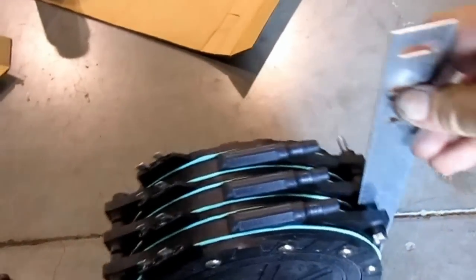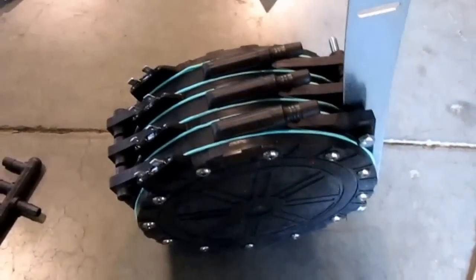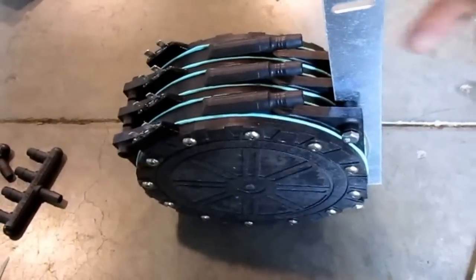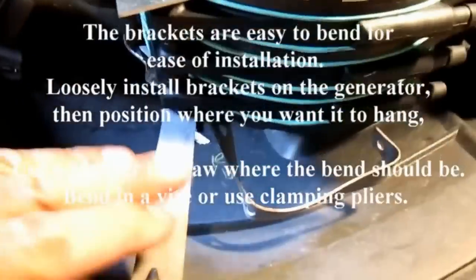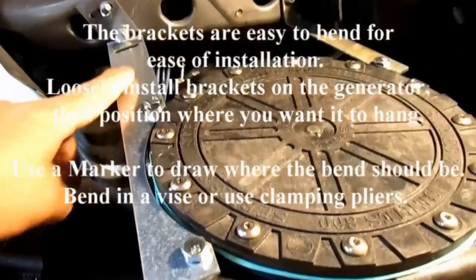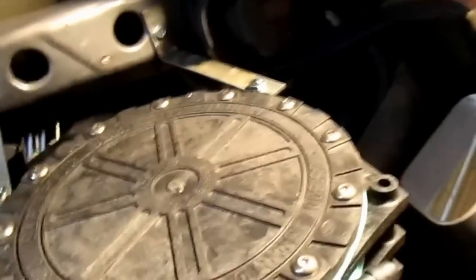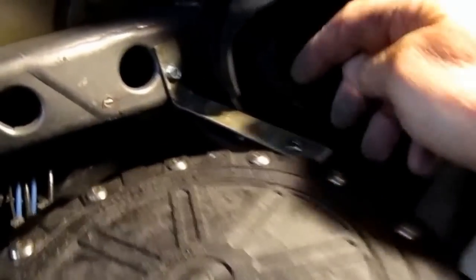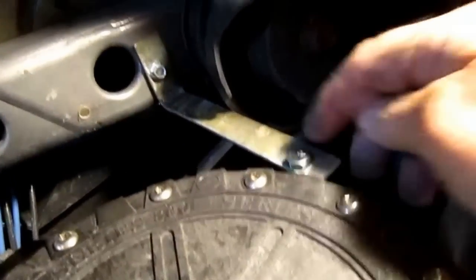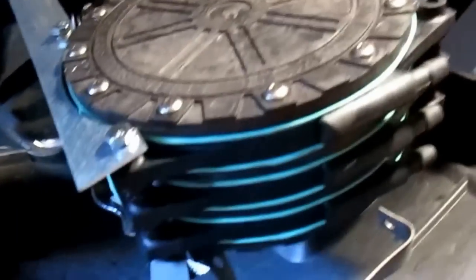That gives you the best opportunity for placement, hanging, and balancing inside. You can see I had this bracket here already — I took this one, bent it, and screwed it into the frame. The other bracket was too bulky, so I used some scrap steel, bent it, cut it, drilled it, and screwed it in. I don't even have it tightened down yet, and you can see that's already a good tight installation.